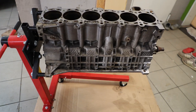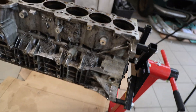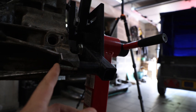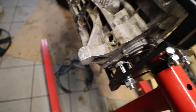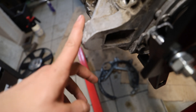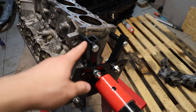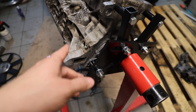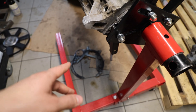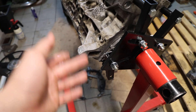I've cleaned the block really thoroughly before starting any work. I'm not going to paint it yet because we still need to fix this — some of you know from the previous video that the thread is broken. Because the threads on the old piece were mangled, we just cut it off and completely filled it back up. This side is already filed down and completely flat. So now we just need to get the gearbox out of the car, mount it with the other three mounting spots, and then cut the thread in a position where it's going to mount up 100%. I decided to do it with the actual gearbox rather than just the bell housing plate, so I can be 100% sure.